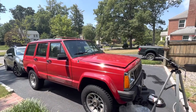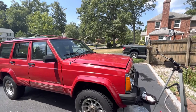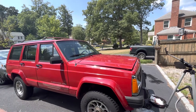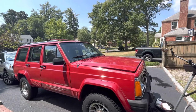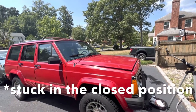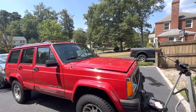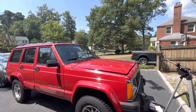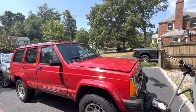I haven't made any videos for a while — it's been so hot I haven't really been doing any car maintenance outside. But this car has been overheating and I want to try the low-hanging fruit: replacing the thermostat. I want to check if it's stuck closed, because if it is, it's not circulating coolant through the radiator. I already burped the system and there were no air bubbles.